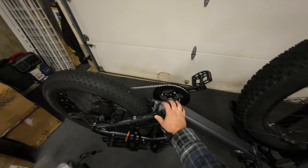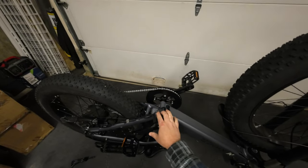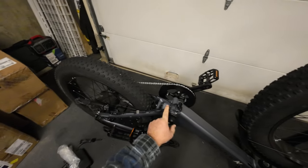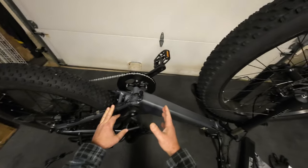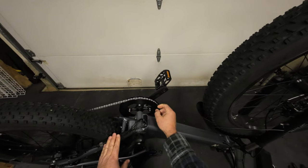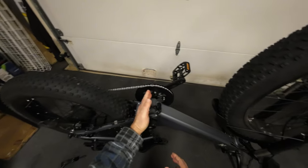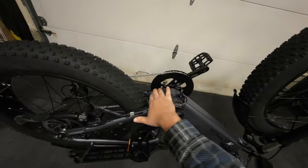While the bike is upside down, I really wish these bikes would take care of all these exposed wires underneath. It's not easy to hit a rock there, but if you do, it could sever wires, cause a short, start a fire, or cut power completely. This is the pedal sensor, the power line to the rear motor, and the disc brake line. Mockwheel, if you're listening — please put some kind of molded plastic or aluminum cover over these wires. The chain guard is already aluminum, so the same material would work perfectly.